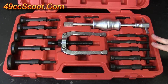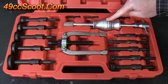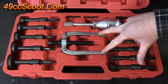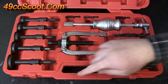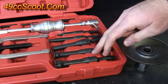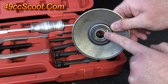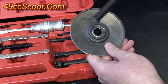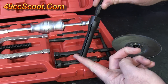This is the bearing extractor kit that I'll be using — the slide hammer style puller. It also has a puller with legs on it but don't use that if you have this kind of kit. It's got a bunch of different attachments to fit multiple bearing sizes. I'll need to find the largest of the puller attachments that will fit into this rear needle bearing, and I've already checked and it will be this largest one. That'll be the first puller attachment I'm using.